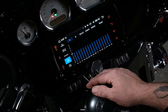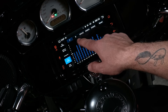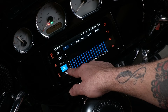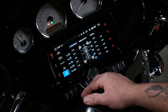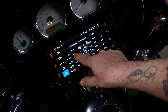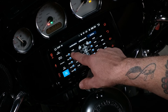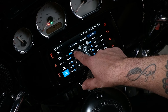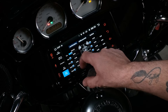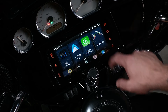After your crossover, you have your EQ where you can add and subtract from wherever you want on each channel. You also have a reset where you can keep it completely flat. Last on this screen is your time delay, where you can delay the time in which the music hits your ears in either centimeters, milliseconds, or inches. So if you hit inches, that's 40.16 inches, or 102 centimeters, or three milliseconds. Reset that back. Now we'll use our back button, which is just under our home button on the right hand side, and go back out.